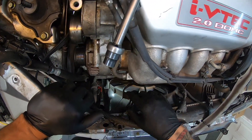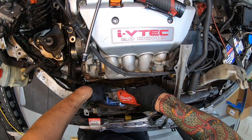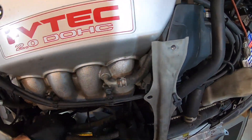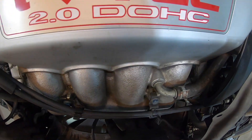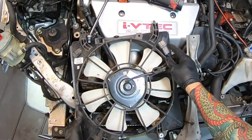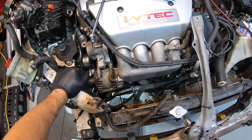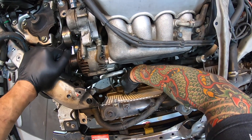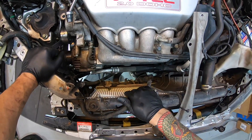You've got a clip here and a clip here, and there's just a connector down there we're going to have to disconnect. There's a plug at the bottom right there, and there's a little retainer for the compressor harness. Now look down there — you've got both compressor lines, low side and high side, and the fittings on the compressor. It's going to be some 10 millimeters. We're going to take those off and move the lines out of the way. Just be careful because there will be some oil coming out — it's going to start getting kind of messy.